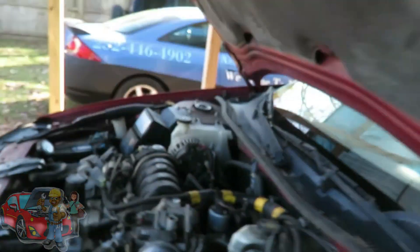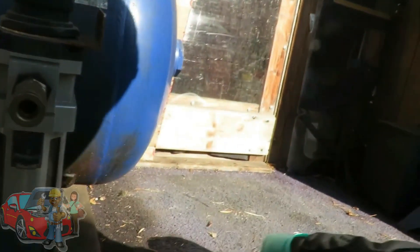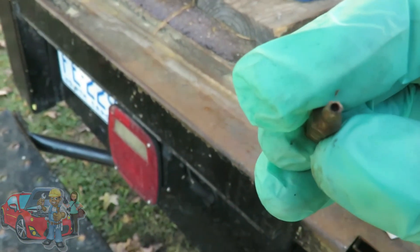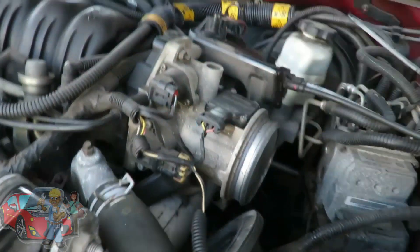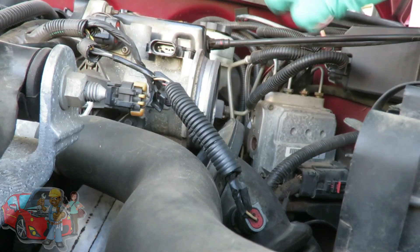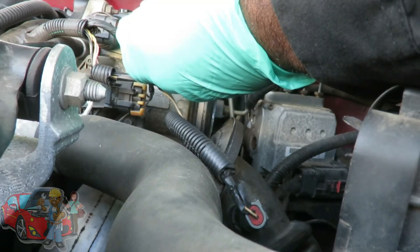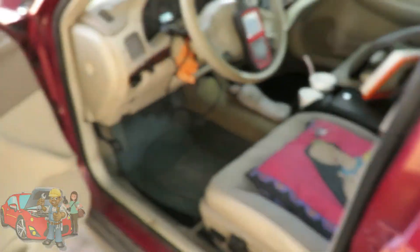Let's go out here. We got our brand new one. We're going to need a T20 Torx security bit — that's the one with the little hole in the middle. Let's reach up under here and unplug the old sensor. Let's get the new one out. Without even connecting it yet, without even putting it in there, we're just going to plug it up and let it hang out there. Let's go back to our Autel AL539B.